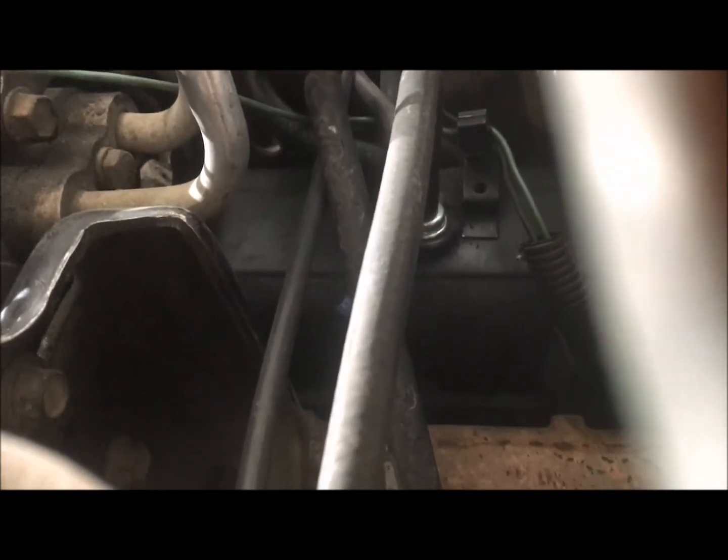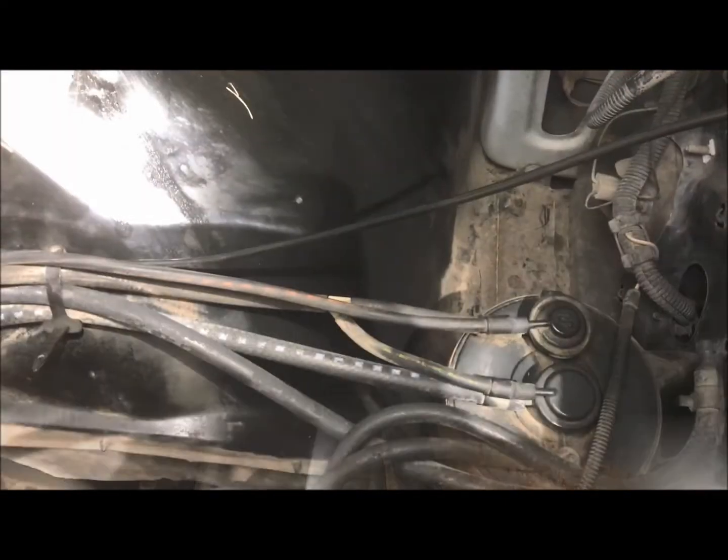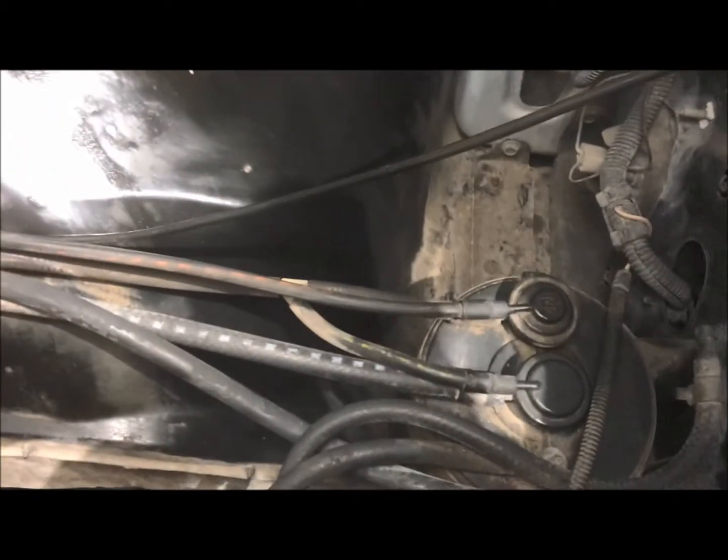Let me ninja the camera in there — there it is, sitting right on top of the motor. That little gray chunk right there by those wires. Repositioning the camera to get closer: on the rightmost side of your canister, follow the large line we traced up to the PCV valve, which is this guy right here on top of your valve cover.